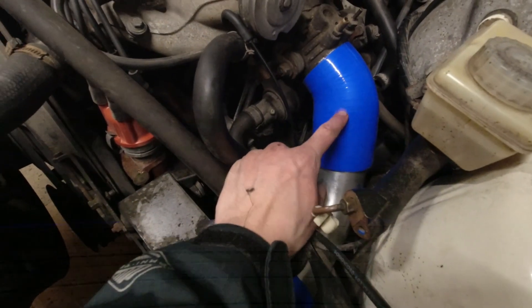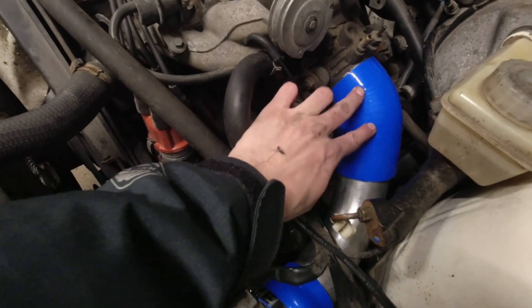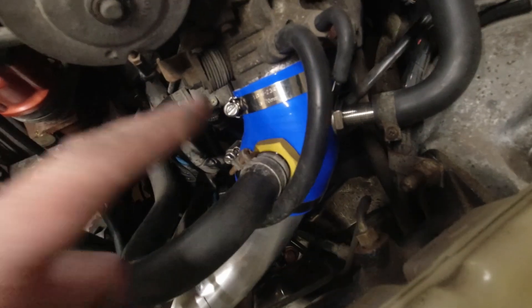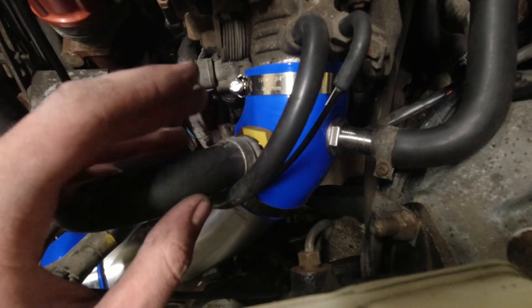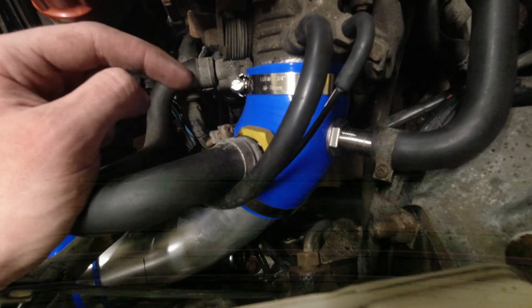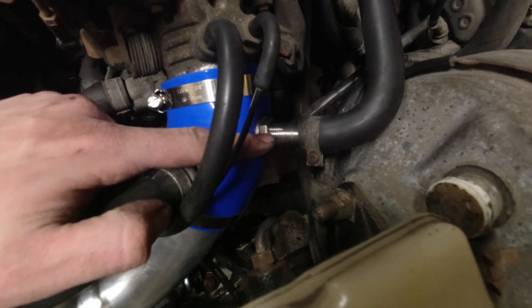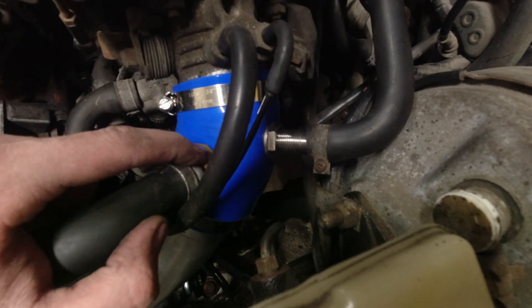This piece I still have to trim, but I have all of this space to mount two ports. I got the two ports installed for the idle control valve and the PCV — these are just marine through-hull fittings. They aren't under a whole lot of load so they don't have to be anything fancy; one was from Amazon, one from eBay. There's a little bit of vacuum here but not much and hopefully these do the trick. One draws a little vacuum for the PCV and also winds up having oil drip through it, and the other is just a little bit of airflow for the idle air control valve.